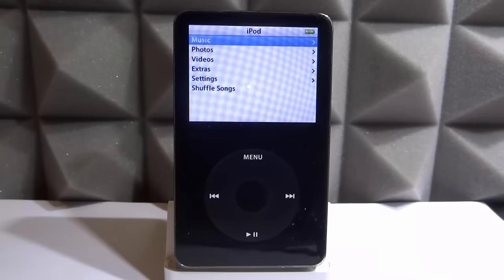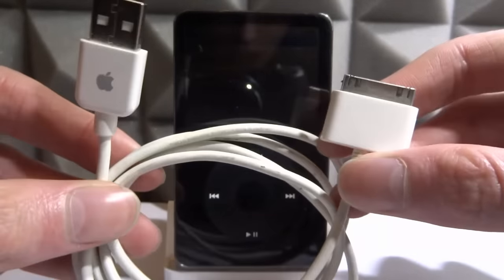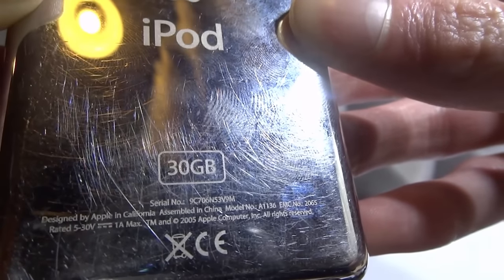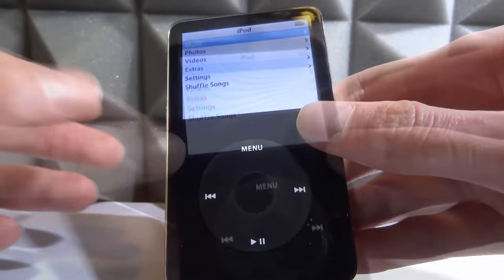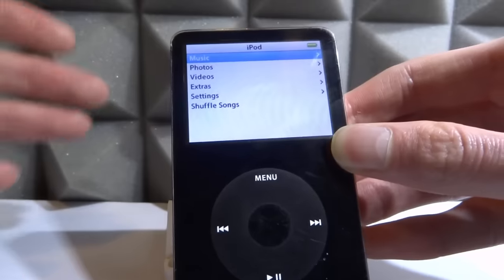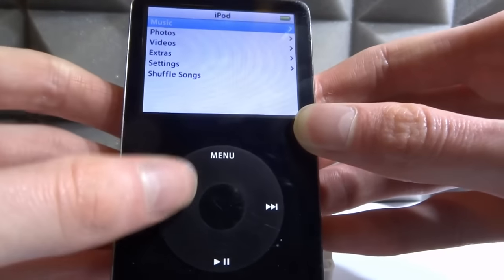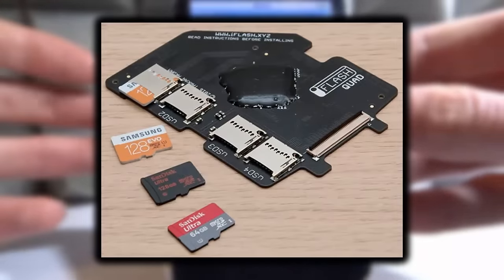The first thing we want to do is connect our iPod to our computer. I'd recommend using the original Apple cable — this will work the best — but any of these old style cables should work fine. On our iPod we need to take note of the model number. Mine is A1136. The cool thing about Rockbox is it lets you run the original operating system as well as Rockbox, so you basically have two operating systems. The only thing it may not work with is the SD card motherboard — if you have that installed rather than a hard drive, you might have some problems.